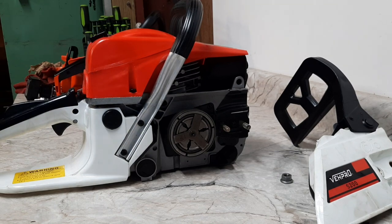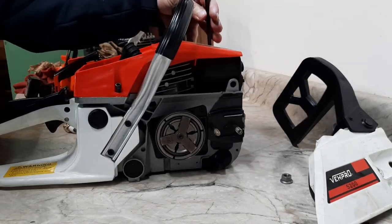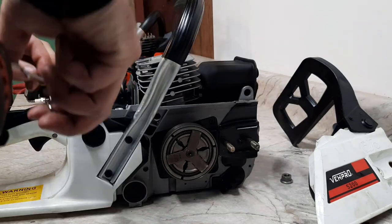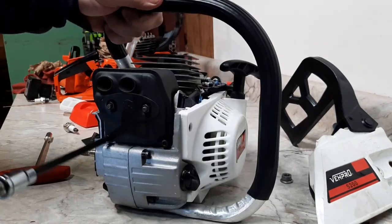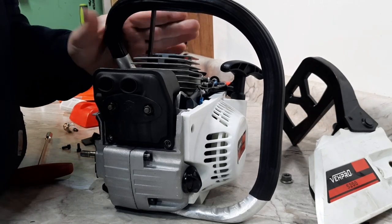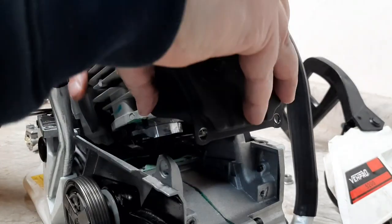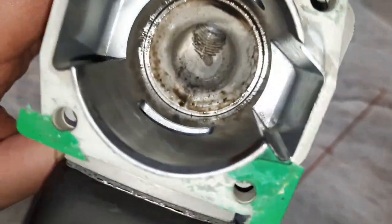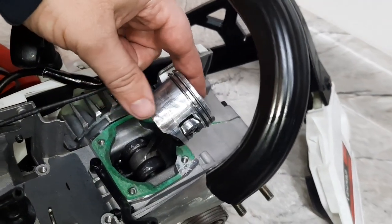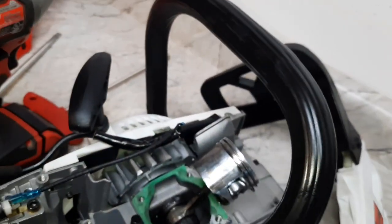This will just be a real quick teardown since the saw will probably be junk anyway, but here we go. Put these on so we don't lose the fuel. There we go. There's a peek inside the cylinder — big open port, no marks on there. The case — a couple little marks on the piston. Not bad, that's just wearing in. All right, let's go do some grinding.